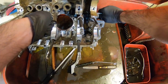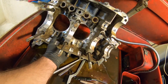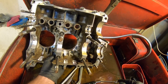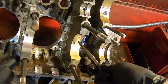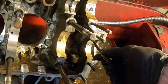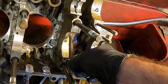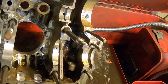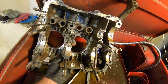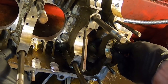I discovered if I just insert fluid into that hole we're good to go, but the fluid leaks in other places — basically you've got to plug your oil cooler holes. Underneath here is where your oil cooler holes are. Once I get those plugged, you can see the oil is coming out of here and it's barely trickling out over there. This is one of the most important ones because this oil galley is a lot smaller than the rest of them. Before we move on to the rear, I'm going to plug that hole. Now you can see that the fluid flows out of there a little better and is starting to flow out of here — that's a good sign. But we haven't seen it flow out the back yet, so we're going to plug this hole now.